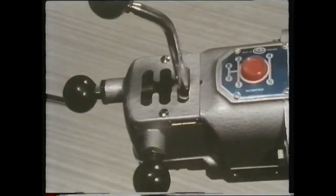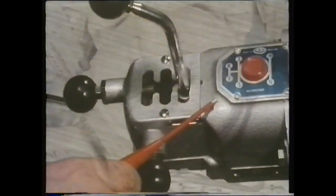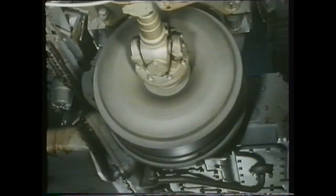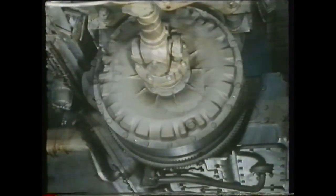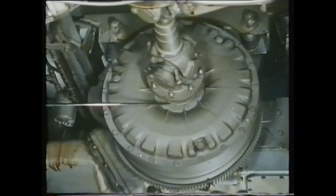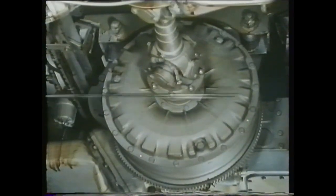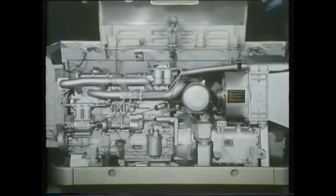Here, the engine is running and a gear has been selected. The handbrake has been released. Therefore, the small prop shaft from the flywheel should be turning to provide vehicle movement. If it isn't, then there's insufficient oil in the flywheel to drive the gearbox. Therefore, stop the engine and examine the area around the flywheel because an oil leak, usually from the seal of the flywheel, would be very much in evidence.